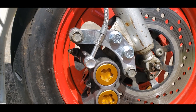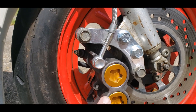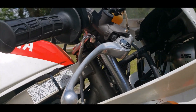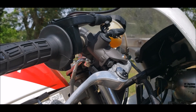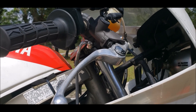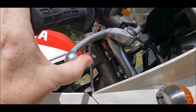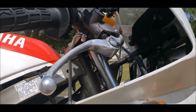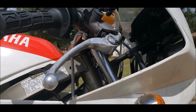When you do this, you've got to think about the ratio for the brake system. You figure the area of each bore inside the caliper, total those, then divide by the area of the piston bore in the master cylinder. When you go to a bigger bore you get a firmer feel but you're decreasing the leverage ratio — that's why it's firmer. Road racers like that because the brake lever stays far away. Street guys generally like smaller diameter master cylinders for better feel, though it takes more lever travel. This setup is the definition of wooden feel, so if I had to do this again I'd go to a smaller diameter master cylinder — definitely go smaller.